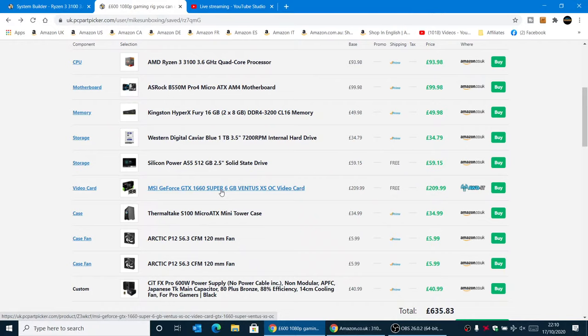Braden Nielsen said, last time he put his operating system on a mechanical hard drive, his computer is extremely glitchy. Is it probably just a result of a faulty mechanical hard drive? Possibly is. I would never recommend putting an operating system on a mechanical hard drive these days. Windows 10 has been optimized so heavily towards solid state storage that on a mechanical drive it may not be glitchy but it seems very slow, because of the way Windows does the file allocations and all that kind of stuff. On a mechanical drive it will feel glitchy because it is so much slower, the transfer rates.